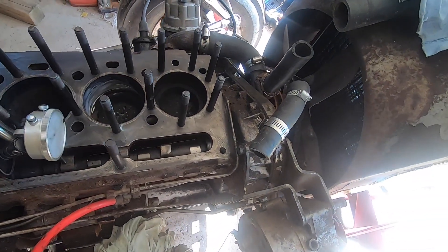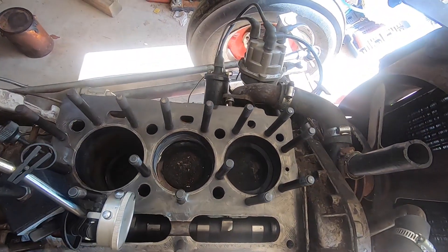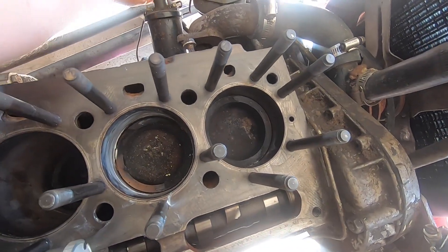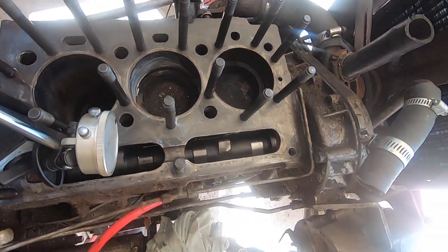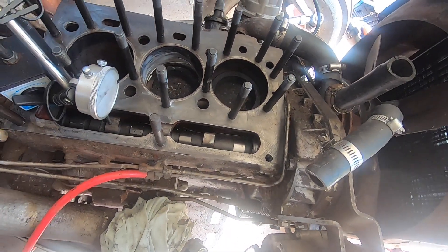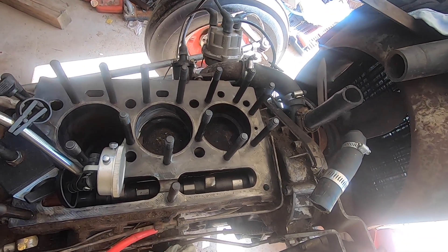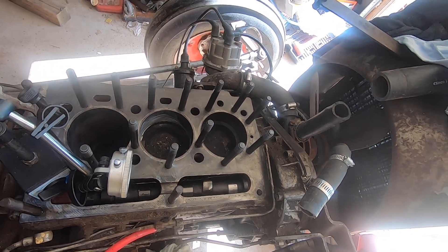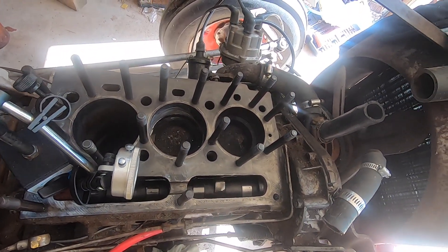I basically still don't know what I'm doing. I have found absolutely nothing - besides when I popped that coil cap off, one of the little ears had fallen off, so that's a pretty good indication of why I couldn't get it started the other day. Normally this is actually a pretty good starting tractor - just pull out the choke, crank it over a couple times, fires right up. The idle is pretty good, but now it's been starting to run rougher and rougher. I think that's because the ignition system doesn't look quite right or it's got some wear.